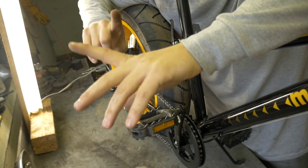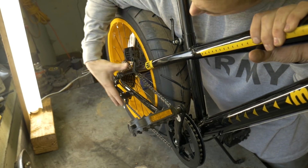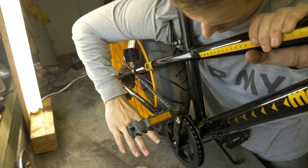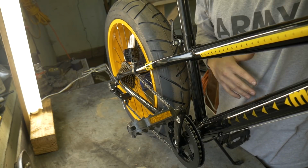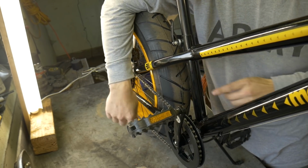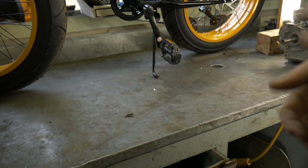All right, guys, so here's what's gonna happen. I'm gonna make it a lot like that two-stroke shifter bike that I made a while back. Basically, we're gonna keep all this intact. We're gonna have the gear shifter. We're gonna have this chain, except I'm gonna cut the pedals off. I'm gonna weld a new sprocket around this and basically put an engine right here. And we're gonna run a jack shaft to the other side and then a chain from here to our new sprocket. So also for this project, I'm gonna give you folks the choice of what engine to use.